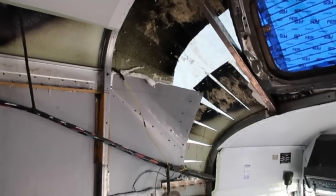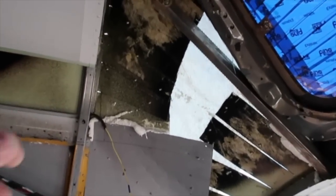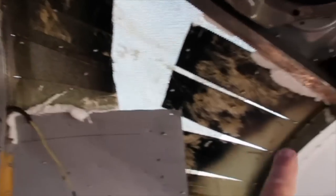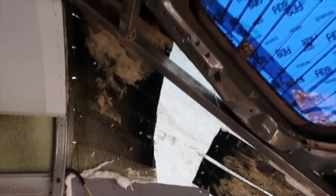Double sticky tape decreases vibration and sound noise, and it's so very strong that it actually works as good as rivets. So I'm putting far fewer rivets than I would have without the tape. You can see about where I cut the roof — top and bottom — and after it was cut, part of the roof was sticking straight out and part straight in. For me it was easiest to go ahead and frame in my back window.